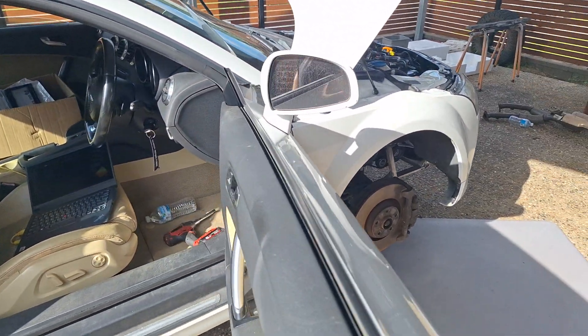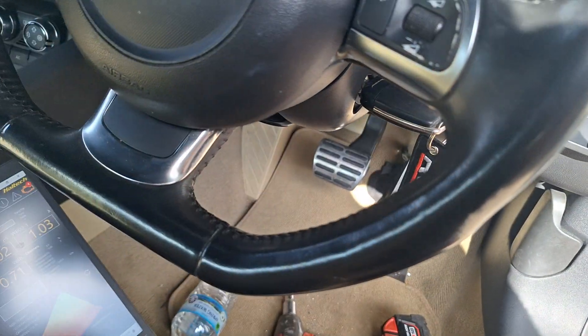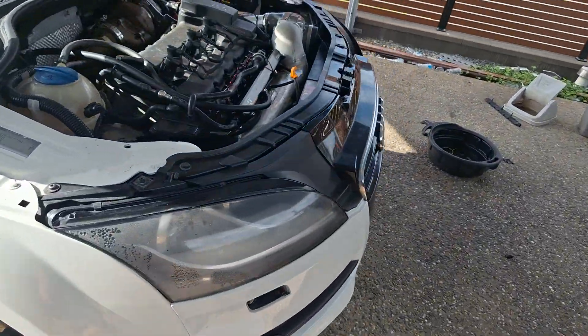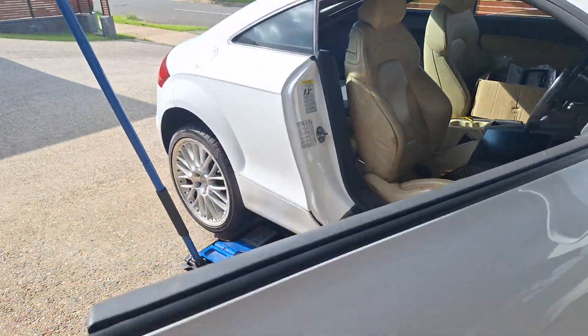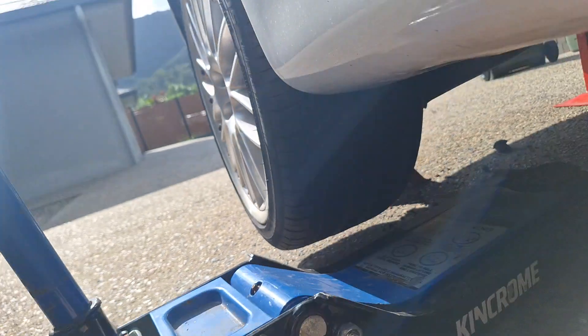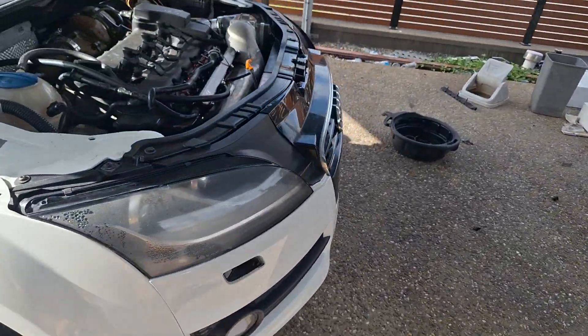The only other thing I was looking at was changing the fuel system and putting in a fuel pressure regulator, but it turns out these cars run the fuel pressure regulator in the filter just in front of the rear wheel, and it outputs four bar of fuel pressure. That is going to be good enough for what I'm doing with low boost. At most I might need to put a bigger fuel pump in.